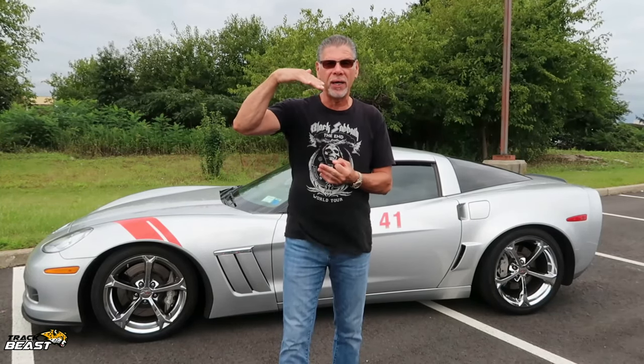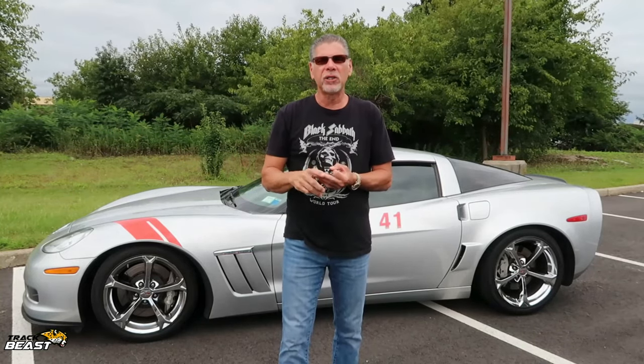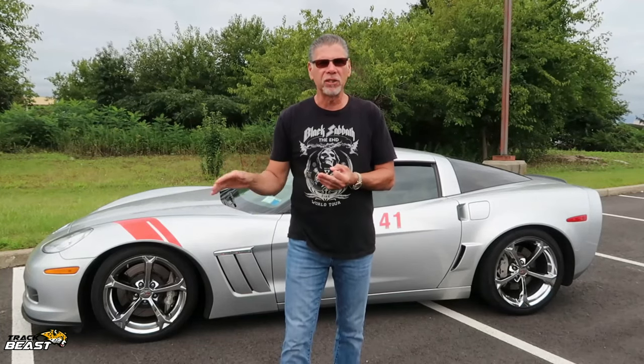Number three, when I was back there, I noticed that the height adjustment bolts and pads were worn out and they were also at the lowest position, and this car was riding very, very high in the rear. So I bought Eibach lowering bolts, which I'll show you a picture of. And I installed them in the rear. The fronts I left, I didn't have time to put them in the front, but the front's fine. All my problems were in the rear.